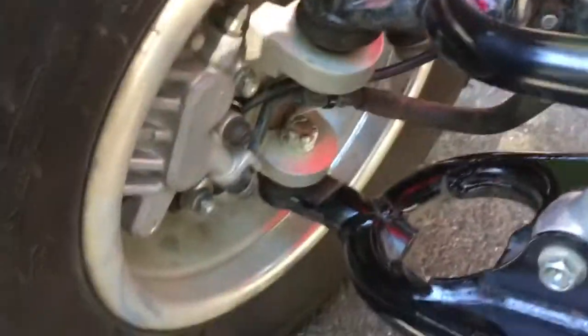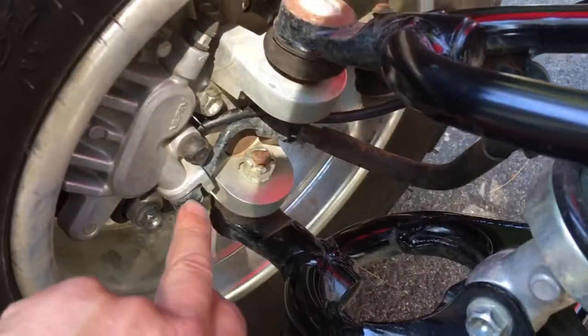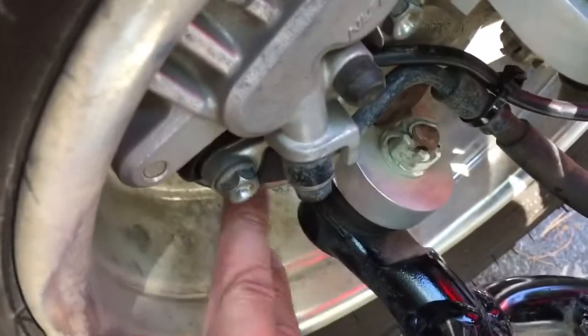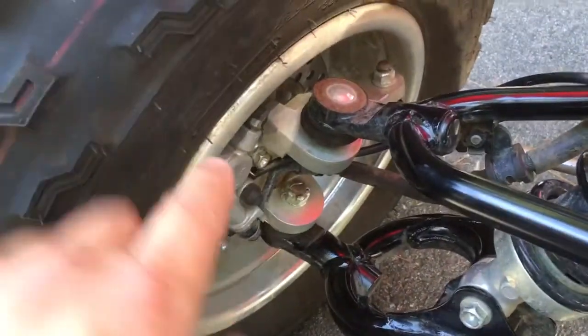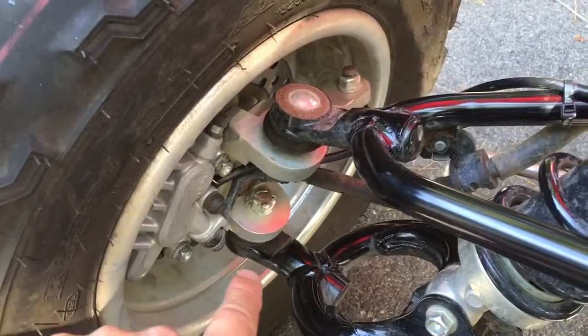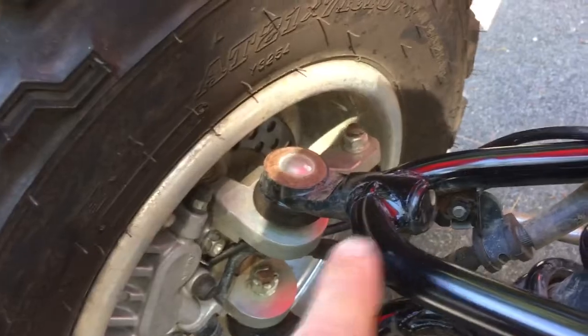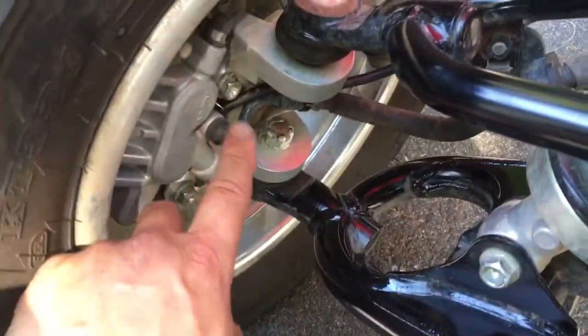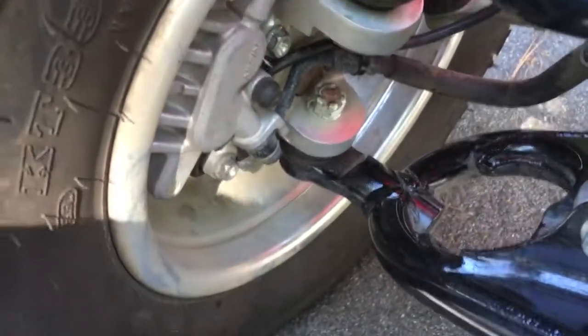When installing this, you have to put a sensor for the speedometer up front on the 450R. It consists of drilling a little hole right under here so you can hook up the sensor. It comes with a self-tapping screw. You have to take the wheel off, take the caliper off, and drill the hole. You've got to take a bolt out of the brake rotor — it comes with a magnetic bolt, so you replace one of the bolts with the magnetic one. Every time the wheel comes around, the sensor counts it and it knows how fast you're going.